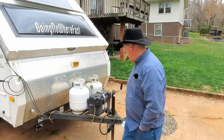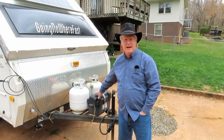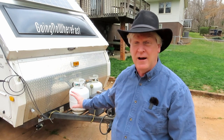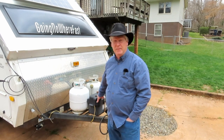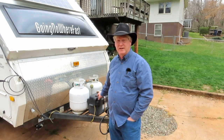One of the first things I ever did with my A-Liner was change the battery. It came with an 80 amp-hour Group 24 battery and I changed it to a Group 27, which is a 100 amp-hour battery. That gave me quite a bit more power than I had before and made it a nicer setup.